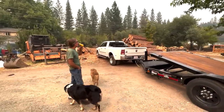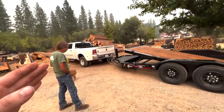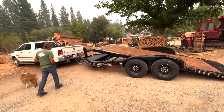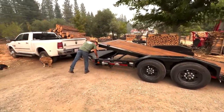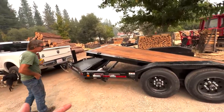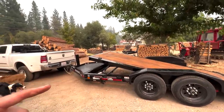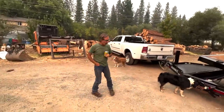I need to inform people: in California, non-CDL — if your trailer is rated for more than 10,000 pounds, you have to have a CDL. Technically this trailer could be like an 18K trailer, so we're going to derate it. The only things he's going to be hauling on it are the wood splitter, the wheel tractor, and the lift — those are his three machines.